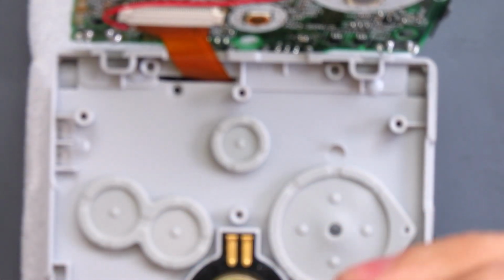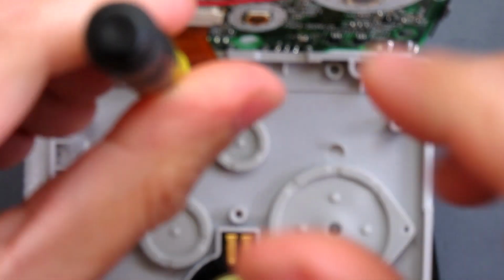Screw to hold that is the longest one, so you've got all sorts of different screws in here. It's a crosshead, it's quite a long screw, and I'll just carefully get that into the plastic there. So cutting a new thread in, so if ever you've got a brand new one, remember that there's not a thread in there already. When you're putting a new screw in, do like a half turn in, quarter turn out, and keep doing that over and over, and it'll cut that nice and neatly without the top of the screw stripping or anything like that.